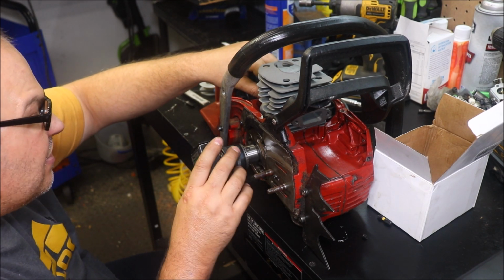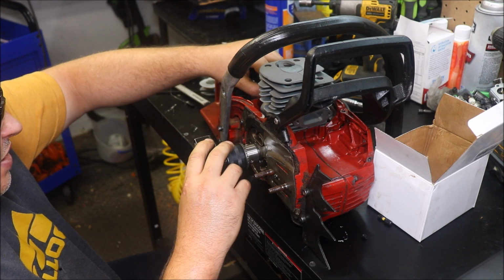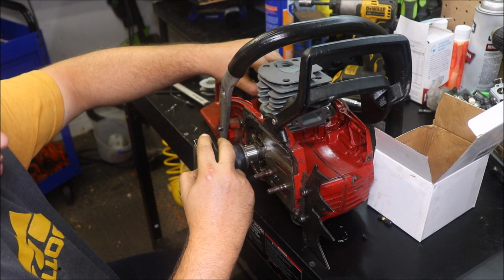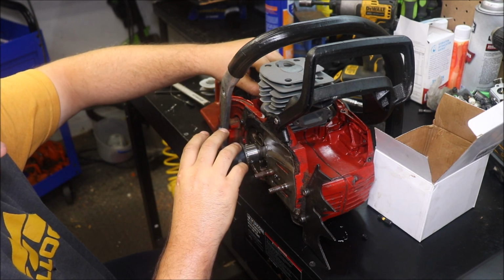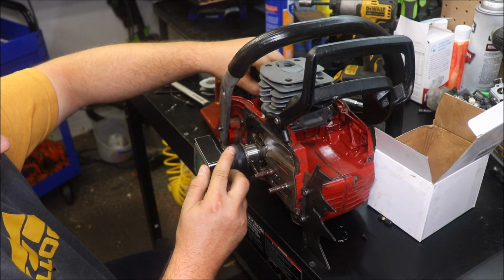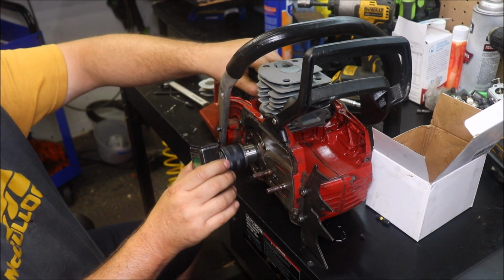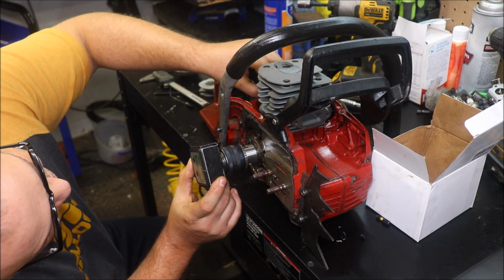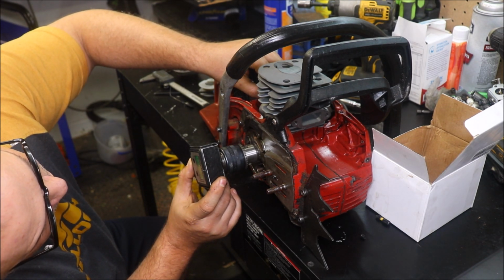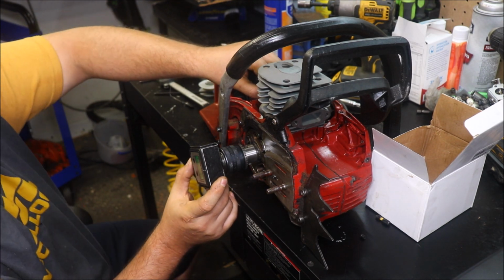Alright. Got my feeler gauge in the very dead center of that intake port. There's a reason behind that. Most ports have an oval shape, so it's best to check from the dead center of that port. We're going to zero that out. We're going to spin it around, and we have 140 and a little bit of change. We're just going to call it 140. It's like 140.1.